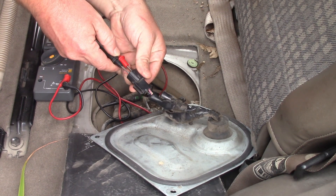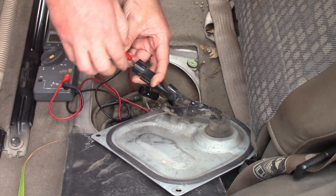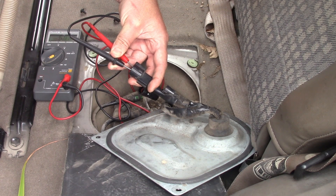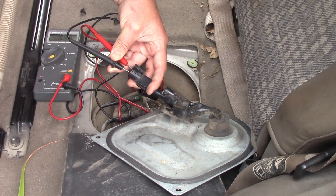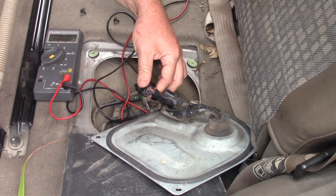I've already checked the inertial switch — it's fine. I'm going to stick my power probe in here. I'm a one-man band right now, so I'll try to hold this with one hand and turn the key on to see if I get any voltage. It goes up to 11.7 or 11.8 and then falls down to 6 volts. Then what happens if I turn it over? Fairly low voltage — 9.2 volts — so that's not real promising; there might not be enough voltage to run the pump.